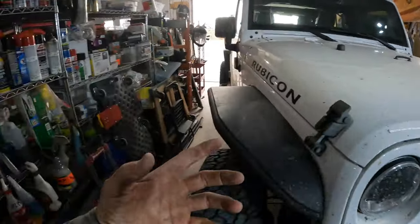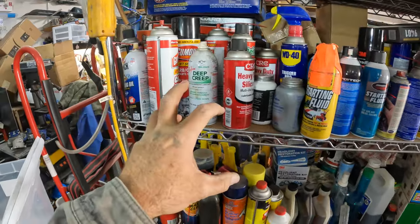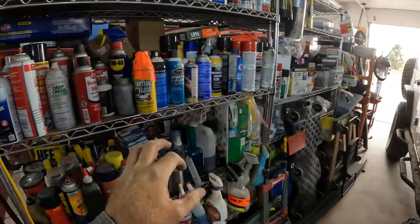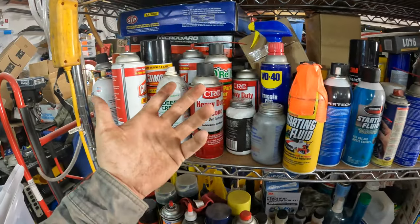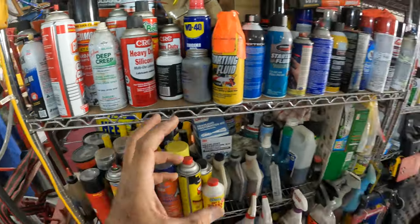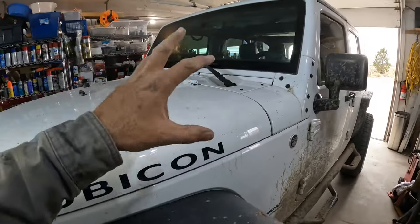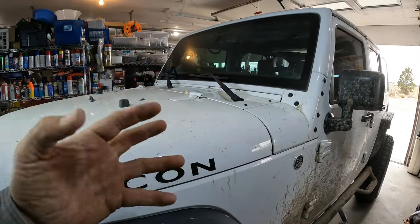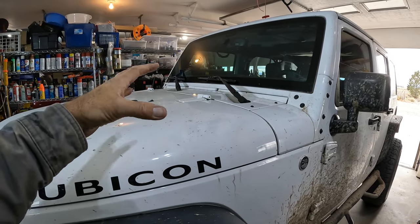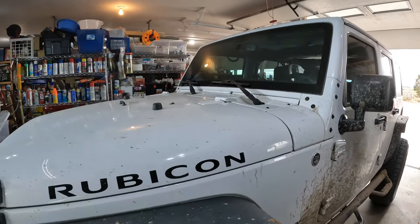It's still going to get dust from vehicles in front of me, but we try not to drive too close to people anyway because then dust comes in the windows. If you're the second, third, or fourth Jeep back there's usually a lot of dust, especially on a still day. So I'm going to carry a can of brake cleaner to wash it out if the mechanism gets grindy and crunchy, then take some lubricant — WD-40 or lithium grease. I also bought a boot to go over the mechanism to help keep dust and grime out so when I take it off to use it, it's ready to go.